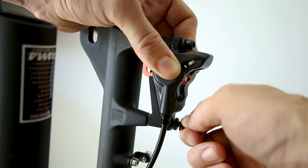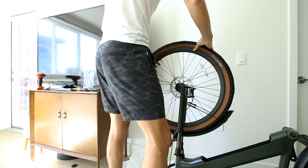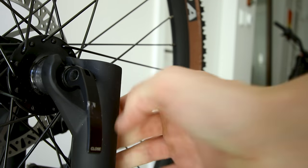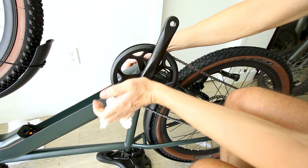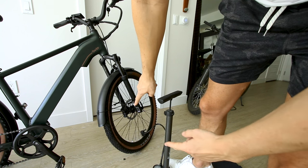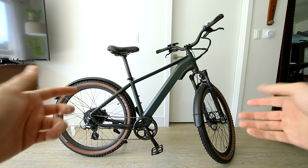Let's put the front hydraulic brake on — you can leave the screws a bit loose until we get the wheel on. There's a quick release on the front wheel for easy transportation if you have to take the wheel off. You can hear the brakes rub a little bit, which is why we didn't tighten that up yet. Tires call for 20 to 50 PSI — I think 38 will do. Here's what it looks like when we're done building it.